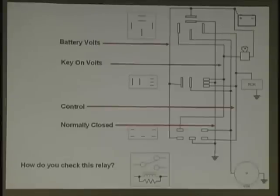And where do you get the output volts? Where's that going to go? To the motor. Right. So we can see output volts. Bingo. Follow that wire up. And the output would be across the normally open contacts. By the way, those are always the heaviest contacts, they carry the most current. And look at this. What is across from the load? Oh, B plus.